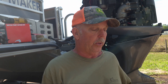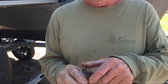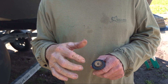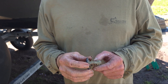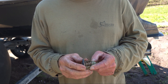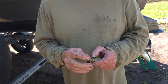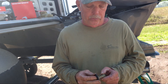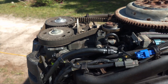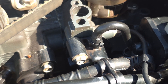The second thing to check if you're still not cooling properly or the boat's not peeing is the thermostat. It's very easy — it just pops out and pops in. There are two bolts on a cover; pop the cover off, pull the old thermostat out of the hole, and shove the new one in. This thermostat heats up and opens and closes as it gets hotter or colder, letting more or less water through. It should probably be replaced every couple hundred hours. For me, this was about 50 bucks.